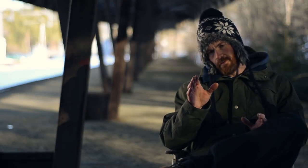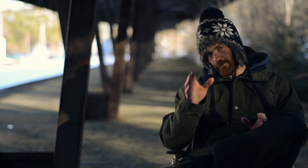I recorded the outro without watching the footage first. First session on gasoline, a slight success. It could have been disastrous. I was downjetting a lot because it was running so rich. I didn't consider that I was running a brand new ring and it hadn't seated yet properly. As I was warming it up and running it, it was progressively getting leaner and leaner.